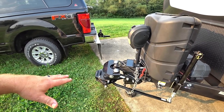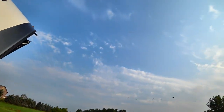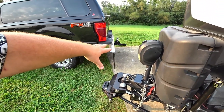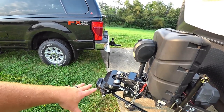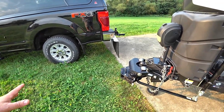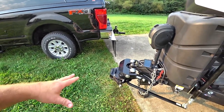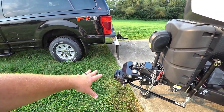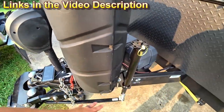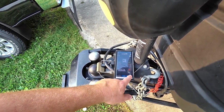Right now what we need to do is get the RV hitch about the right height as the stinger. The stinger hitch height needs to be known before you start backing up so you can adjust accordingly. People do that in different ways. Maybe you measured it right as you disconnect it. We have a Level Mate Pro — linked in the description along with this hitch and these jacks. In my case, I have a Level Mate Pro connected on here, so I can just recall whatever the hitch height was. It says I need to go down an inch and a quarter.